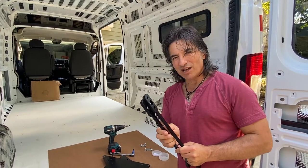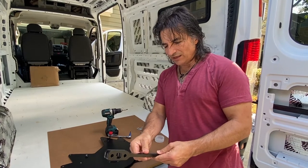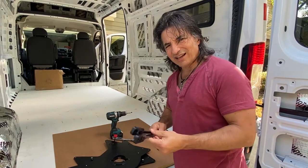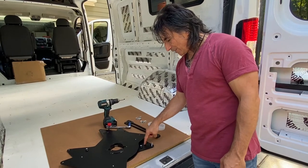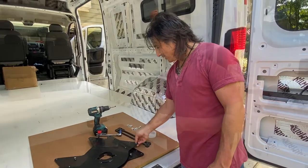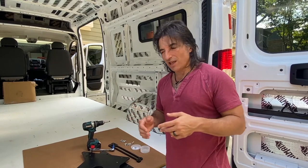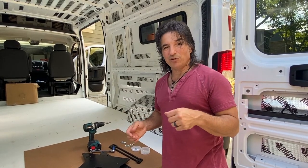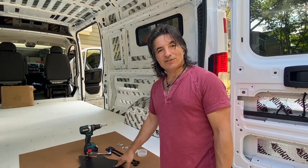The spacers are only needed on the Ram ProMaster. There's a little piece of the seat belt adapter underneath that if you cut it loose, you can actually install without these. We'll try with them and if it ends up being too high we'll just take it out and cut that seat belt adapter. One safety step: we're going to pull the negative battery cable away to remove any power from the airbags, since we're going to be messing with the seats. Everything we've seen recommends pulling the negative battery cable, letting it sit for 10 minutes to discharge any built-up voltage.